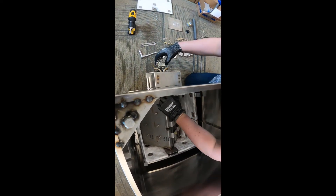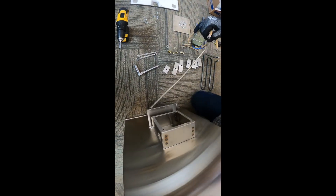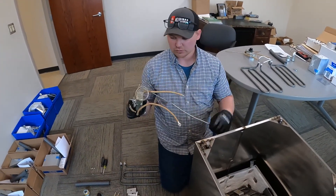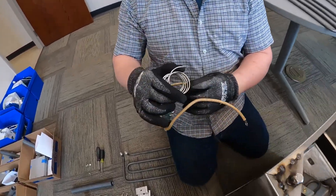Just go ahead and pull it out, one wire at a time, and that's how you remove your control. When replacing your control, all you have to do is unwind one spool — very important not to kink the spool.